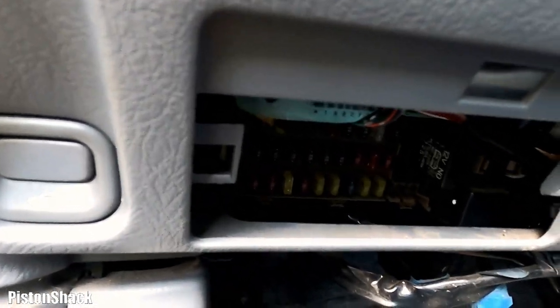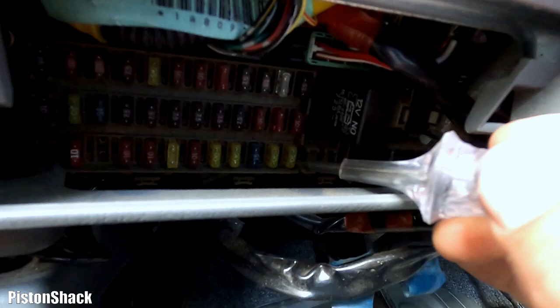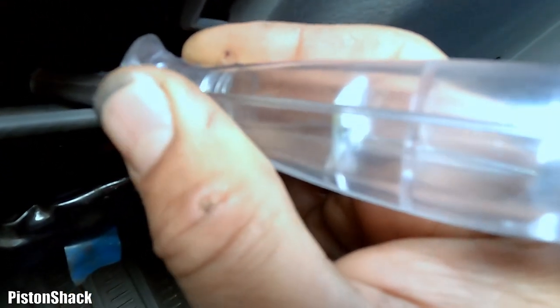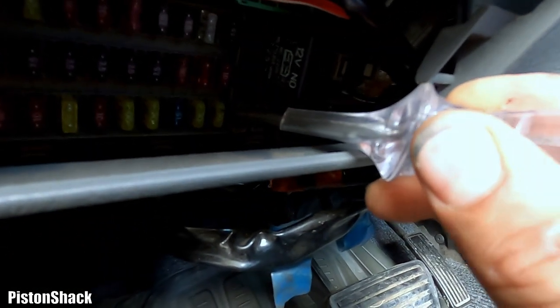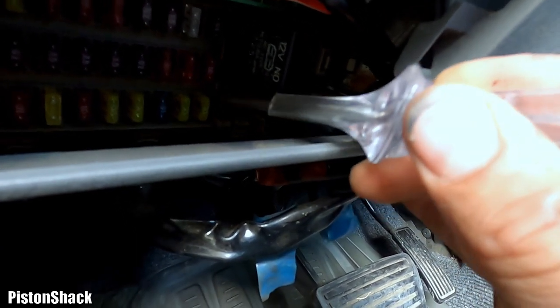Yeah, let's turn the key to the on position to power the circuit. It's ignition fuse. Okay, key turned to the on position. And let's see. Yep, we have power on one leg of the fuse. Make sure you can see it. Yeah, my test light is lit, and we have power on both sides of the fuse. I'm not sure why someone put a 20 amp there, but we'll leave it for now. And yeah, everything's checked out so far.